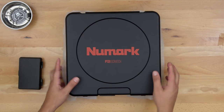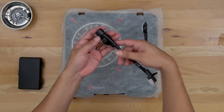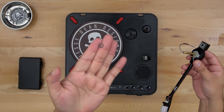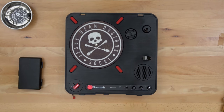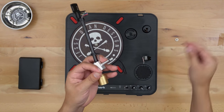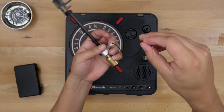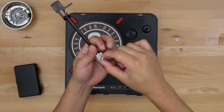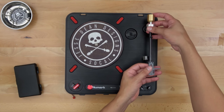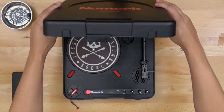The tonearm should now be loosened up and ready to come out. Let's flip it over — there's the old tonearm. The old tonearm has a washer at the very bottom; we're going to take that off and put it on the Jesse Dean tonearm. So let's unscrew the nut off the Jesse Dean tonearm and put it to the side. There's also a clip on here — we'll pop that off and put it to the side. Now let's add that washer we removed onto the new tonearm and carefully feed the cables through.